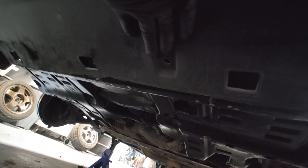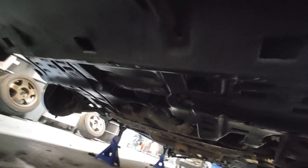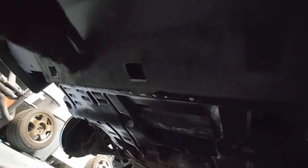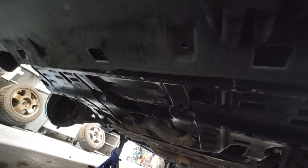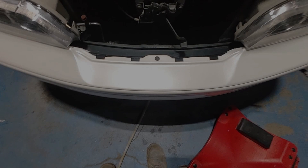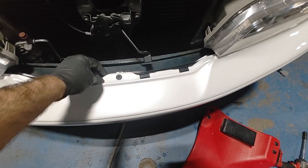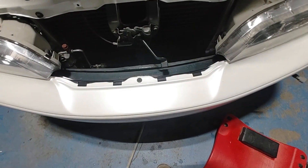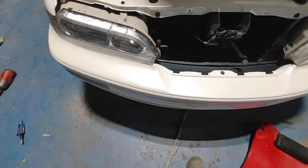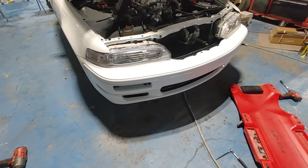The lower middle portion of the bumper should only have two plastic clips holding it up to the car. You will notice three windows in the bumper — those windows are for access to 10 millimeter bolts that hold the lower engine cover on. They are not necessary to remove to get the bumper off. It is also not necessary to remove anything from the top of the bumper whatsoever. The Phillips head bolt you see at the top of the middle of the bumper, you leave it in. We are ultimately going to remove the entire rebar and the plastic bumper assembly together.